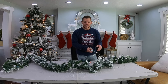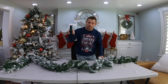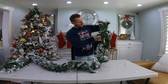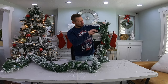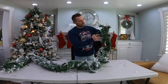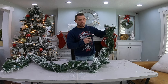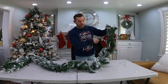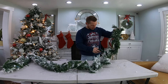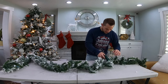So on the table is nice and easy. The garland gets a little bit in the way, but it'll work. With our settings set to incandescent bulbs and our lights plugged in, we are ready to start testing. You start running the sensor over the lights — once you get over the lights you'll get the full circuit and the continuity, and it will tell you. You'll get a green sound. It recommends that you work from the male end plug to the female end plug, because that's most likely where the problem is. So I just keep working down, following all the lights.